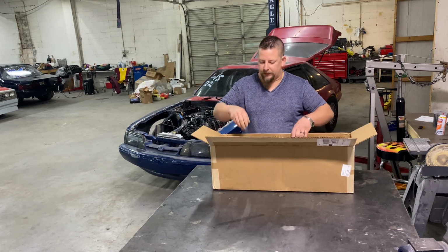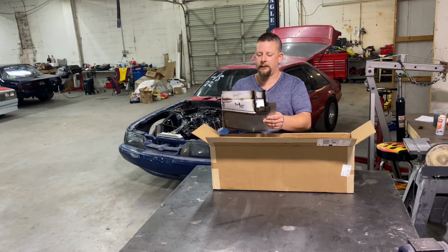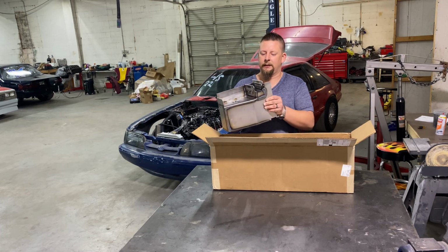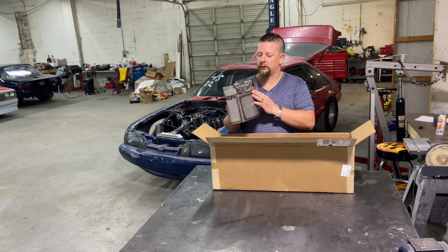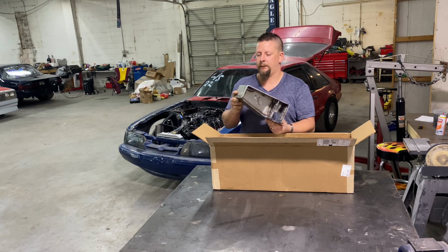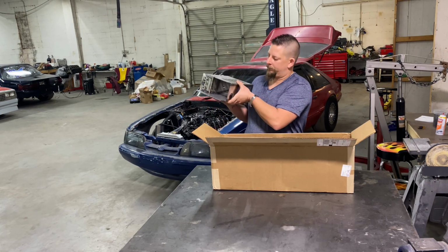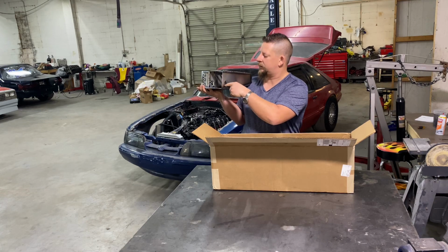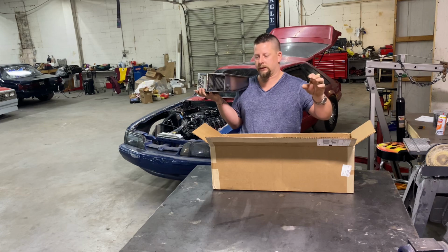And first thing we find on the top of the box is their lower torque boxes. And these things, the quality is just amazing. He double walls everything. Everything is TIG welded. The colors are beautiful. He makes an addendum for lower subframe connectors. If you want to do them tubular, you can slide the bar in here, weld them up, connect it to the rest of the car.